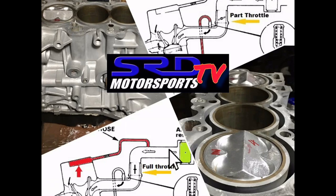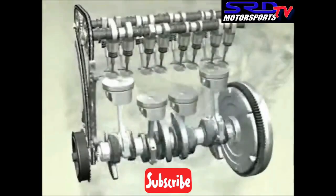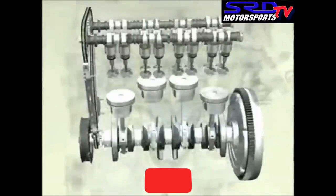Now, a little more on the importance of crankcase breathing. Here's a diagram or animation of an engine. Number one piston, nearest the pulley, is at top dead center, as well as number four piston, which is closest to the flywheel. As mentioned in the piston ring video that you can click up here, when the piston goes down, it pushes the column of air underneath it downwards. And as pistons 2 and 3 go up, they pull air from underneath them. And again, as pistons 2 and 3 go down, they push air downwards to make space.